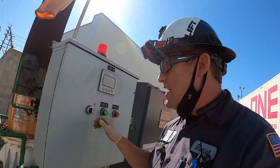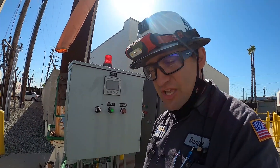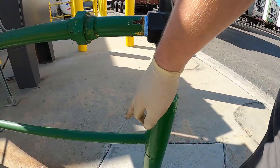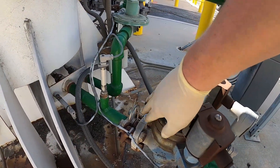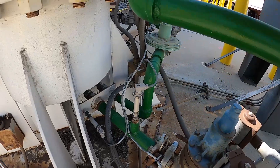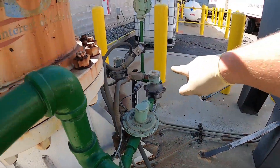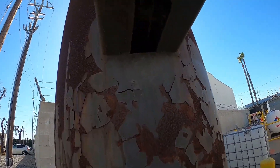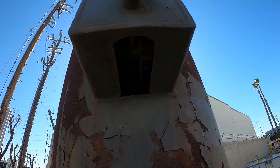I'm gonna go ahead and start it up for you guys so you can check it out. The ammonia would come in through here, go through this pressure regulator to feed the system at constant pressure, then your main burner here with its regulator, and you've got your pilot here. You can kind of see all the flames in there.